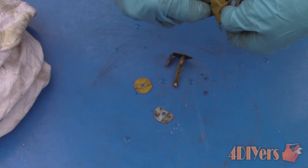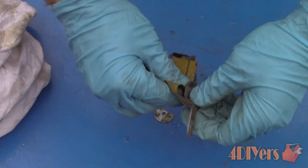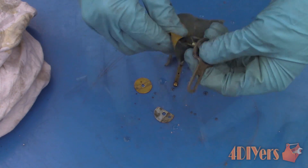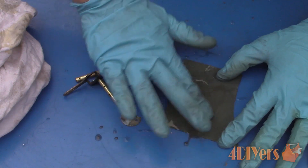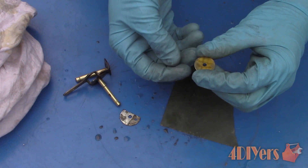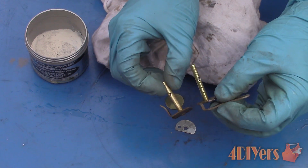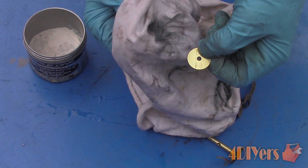Finally we can finish up with polishing the shafts and plates. The shafts on this particular model are made of brass so they are fairly easy to work with — wet sand them down to remove any baked-on debris and to smoothen the surface. One plate is made of brass and the other is steel. Steel tends to be a little harder to work with, so start with 1500 grit wet sandpaper then work up to 2000. For the brass plate, 2000 grit is fine. Then polish the shafts and plates using the metal polish — I have done this by hand but you can use a rotary tool.